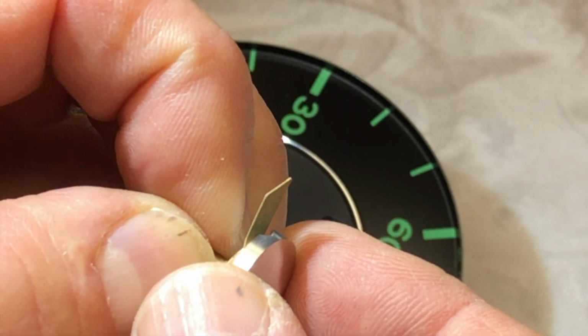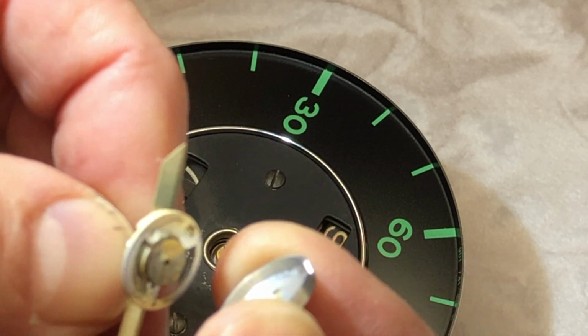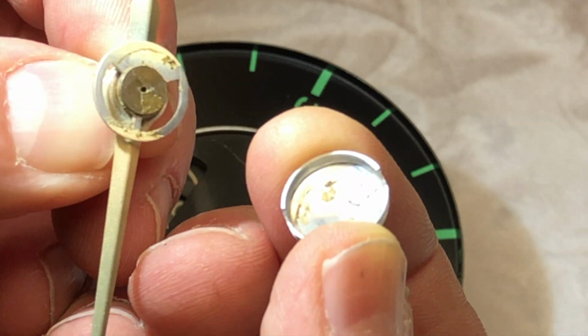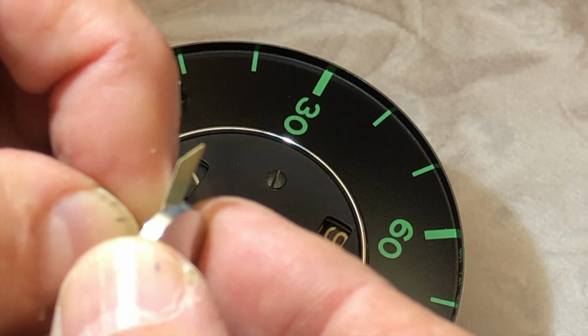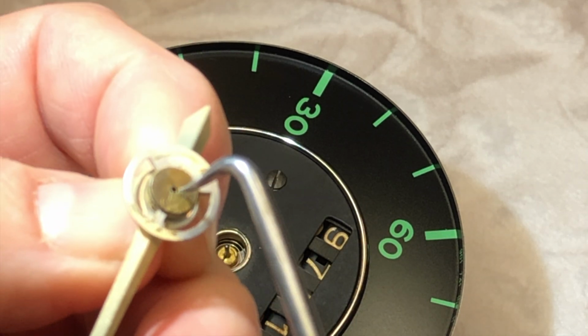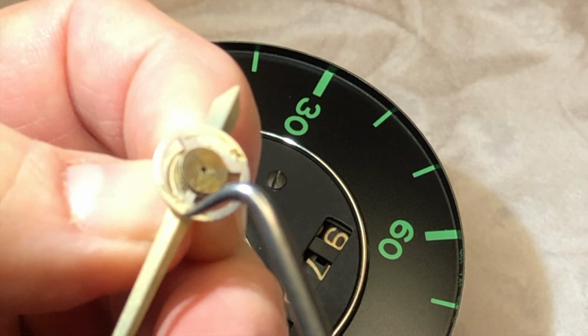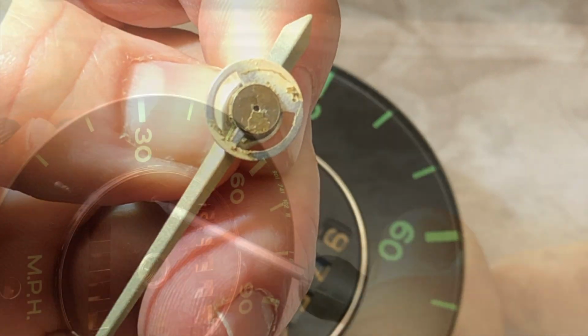And then looking at the cap that presses down over the top of this needle, I pried that off first. Inside was filled with a putty-type adhesive pressed down over the top. You can pop that out first, and then you can gain access to this pilot hole here. Dribble a little KB88 down there, and that should help loosen it up.